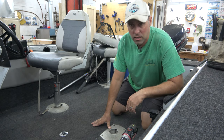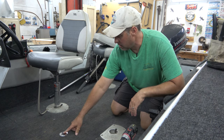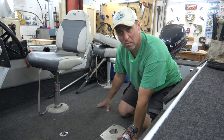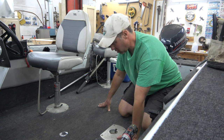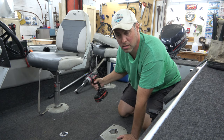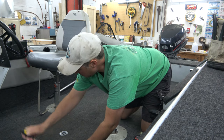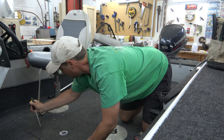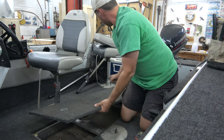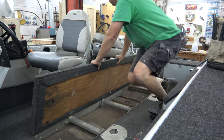To get to your old fuel sending unit you need to find the fuel tank. In mine it's in the floorboards under here. There's a little vent in the middle where it can vent out. In order to get to it I have to take up this whole middle floorboard. I already took the screws out, but if not you've got some screws usually around here — you just pop them out then pry this board out of the middle of the floor. Should expose the gas tank right here. Yeah, there it is. And there is our gas tank. I'll just move this board out of the way.